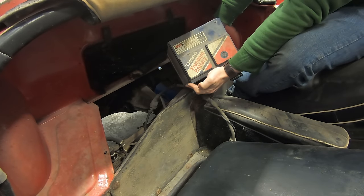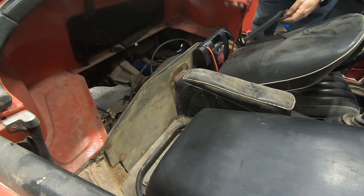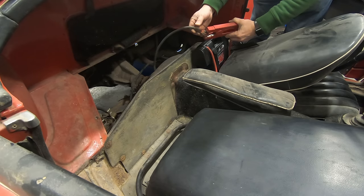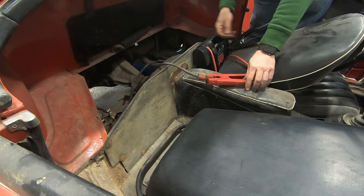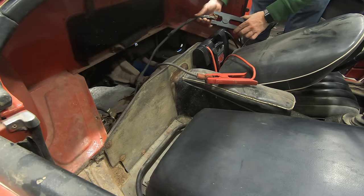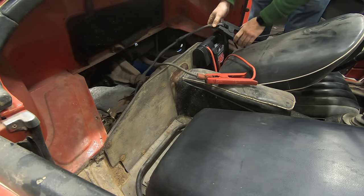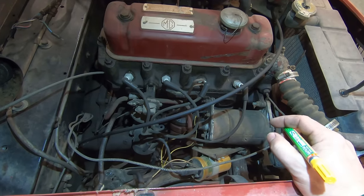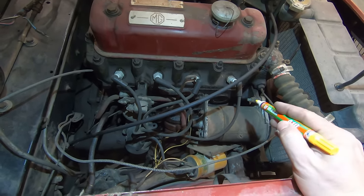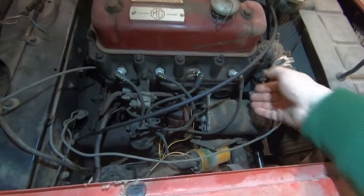You can see by the look of this battery that it's been in here a long time. I'm going to connect up this battery pack. This car is a positive-ground car, so this one is grounded to the body, and the other side goes up to the starter solenoid. I'm going to take the spark plugs out to make it a lot easier to crank over for the first time. Before I pull the spark plug wires off, I'm going to mark them. Okay, now I can pull them off.